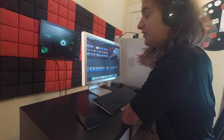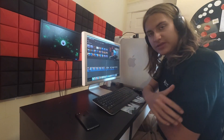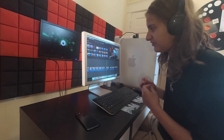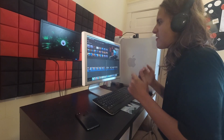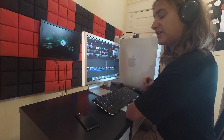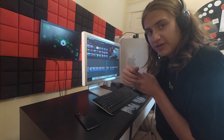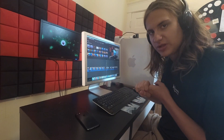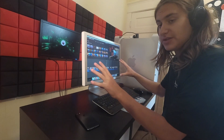However, you can probably hear a fan going back here. The GPU I put in — the HD4870 — is known to run really hot, and I had a bunch of issues with the computer crashing and artifacting on the screen, so I had to jump the fan wires to an external power supply to make them run at full speed. I haven't had any issues since, but I can't record mic overlay audio because it's way too loud, and all my music is on my normal editing PC, so I finished the video from there. But all the video stuff I did on here.